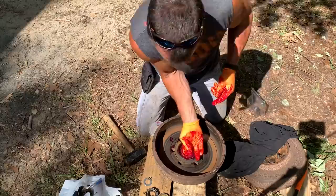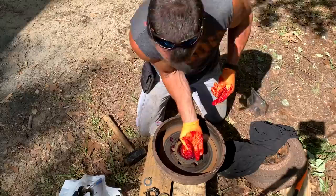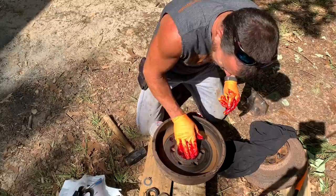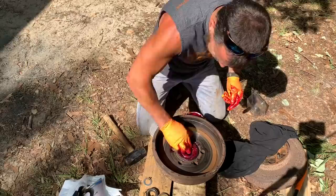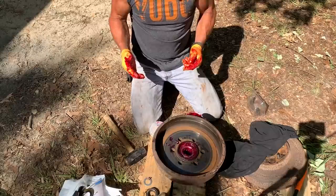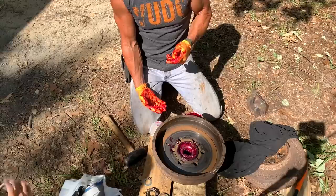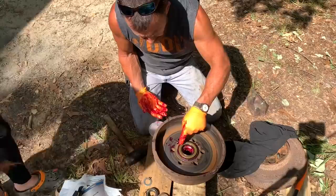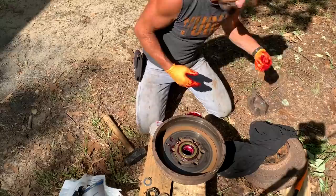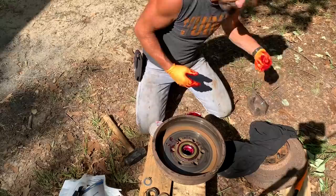This is some messy stuff. That's what I want it to look like right there. And you just take that seal — just lay it right there. Then what we'll do now is take that hammer and just bump that thing in on that side, and you're done. Flip that hub over and put this other one in the other side. We're fixing to put it back together.